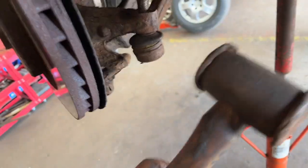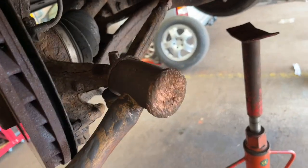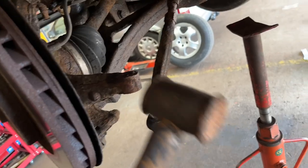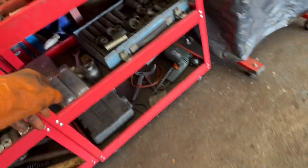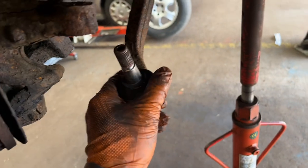You just need to give a little whack to the hub with a hammer — I'll use a copper one. I'm having to do this one-handed, holding the camera in the right hand. I've given it a couple of knocks and it's dropped down. You can use a ball joint splitter — there's one down here — but when I know I've been working on a vehicle and it's been greased, I know it'll be loose. As you can see, that is now spinning free.